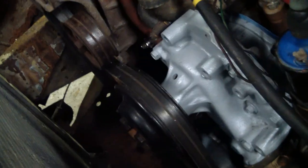It's got a 5-speed T5 out of a Mustang with the cable. There's my clutch cable. I gotta get a shorter belt. I'm going to swap the distributor for an 85 Mustang distributor because it's got the right gear for the roller cam. Probably going to put a 1-inch spacer under the carburetor to pick it up a little bit. Other than that, it's in.